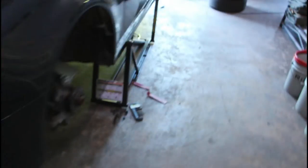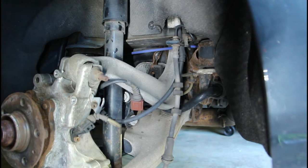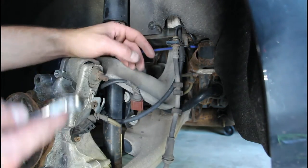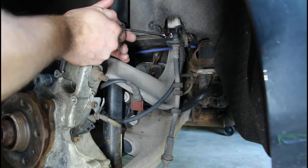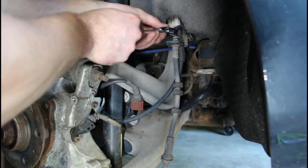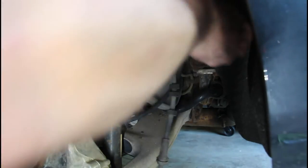We've got a notch — this will work. Let's get started on the other side. This is where things start to get a little messy with the brake fluid, but you just got to get it done. Up here is where you disconnect your brake line, which takes an 11-mil. I like to use line wrenches for that because it doesn't strip them. The flare nut is kind of tight against the line, so it didn't thread in that easily and I had to fight with it a little bit, but it's finally in.